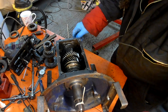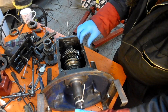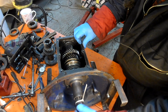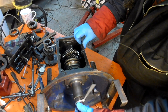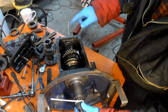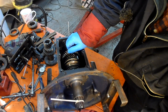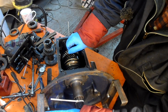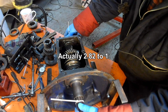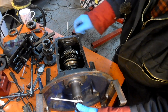This is the input shaft, this is the output shaft. So let's turn this until we've got one turn on there. Can you see both ends? One, two — it hasn't come round to three. So the ratio in first gear is less than three — that'll be two and a half, two and three quarters. So it's about 2.8 to one. I can only give you an approximate figure — 2.8 to one. I'll write the actual number across the screen. So that's first gear.